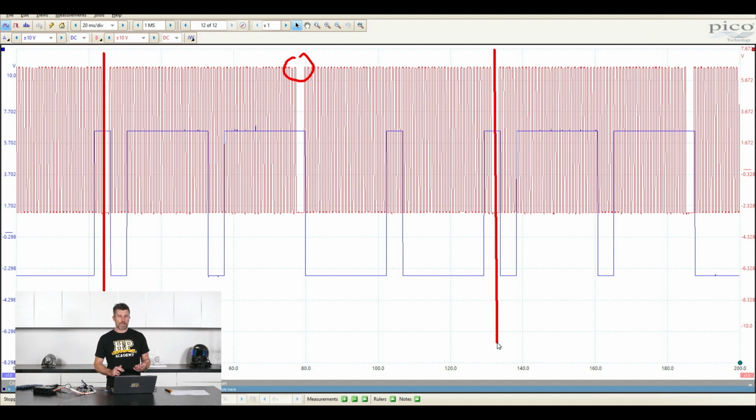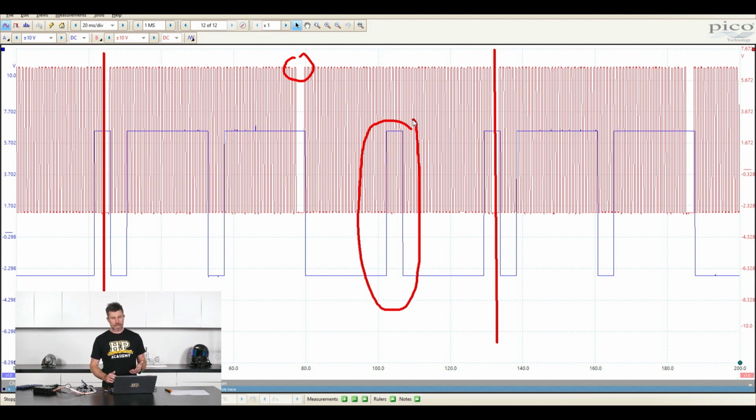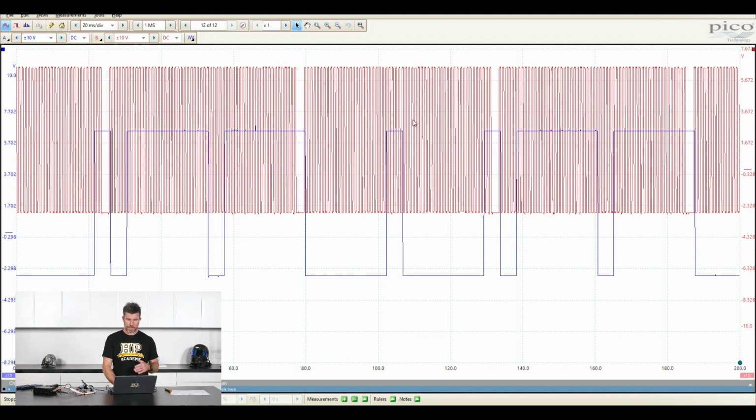So the ECU is looking at the synchronization input, our blue channel there. It's not a trigger pattern I work with much, but we can see that we've got this tooth out by itself. So we've got a short, a long, then a gap, a single short tooth, a gap, and then that pattern repeats. Where that tooth is located relative to our missing tooth gap on our engine speed sensor is what the ECU is looking at to know, all right, I know where I am in the engine cycle, I know which cylinder is firing. And as I mentioned, the alignment of these teeth on our synchronization sensor relative to our engine position can be really problematic in some vehicles depending on the trigger system. So that's one of the things we might be looking for.